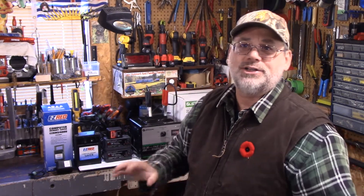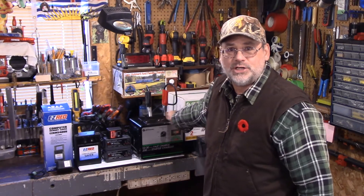At that stage I say go buy a new battery, and they say no, I just want you to boost it — and by the way, this unit here is a booster as well as a battery charger. I say well, I'll tell you what's going to happen most of the time in my experience. When you have a battery that's been discharged that bad and it's not under a year old, it's pretty well garbage. But they say, 'I just want to boost it, start the vehicle and off I go.' I said, okay, but just remember — the next call you might make is that you've got a light on the dash saying alternator.